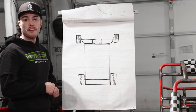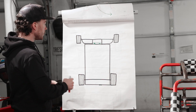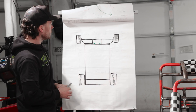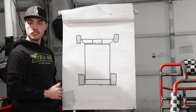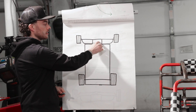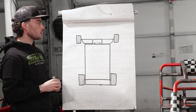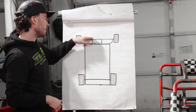Here I have a fairly crude drawing of our go-kart. You can see I've got my rear tires down at the bottom, here's my rear axle, and here are our front tires mounted out on our A-arms. And right here, this green piece is where we have our steering rack mounted. In our case, we're going to mount our steering rack behind the saddle line of our tires.